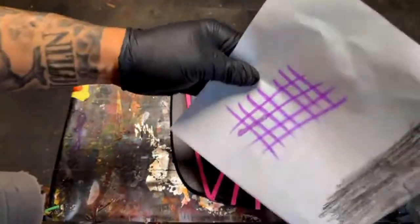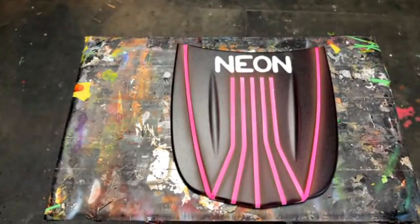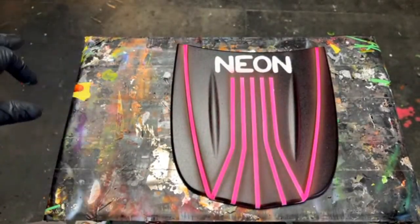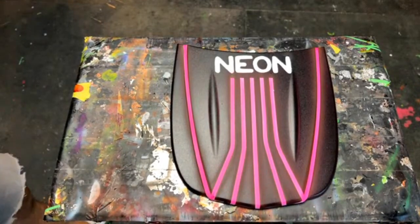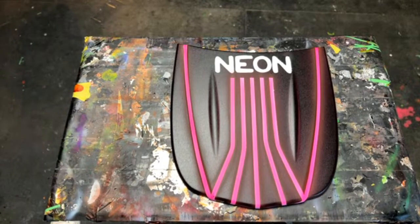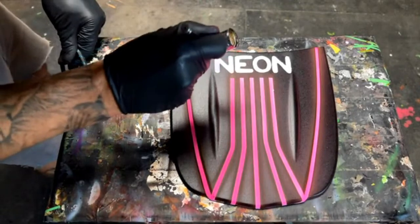Jeremy asked, what is high solids clear for? Very nice. High solids clear is going to build up thicker. It's going to build a thickness to it quicker. Although there are some downfalls, it may not lay out quite as nice. But the trick to that, depending on the brand, you can usually add 10% reducer, and that will help the flow. But keep in mind, you might have to give a little bit in some other areas. I'm not all that interested in high solids clear coat or high build clear coat, as some people call it. I just use good quality clear.